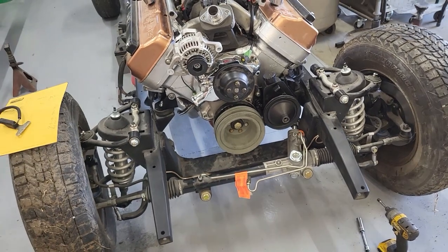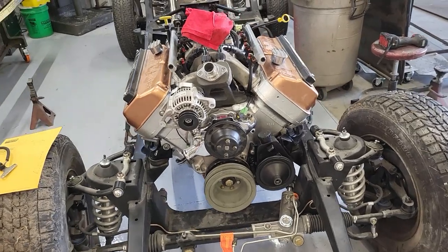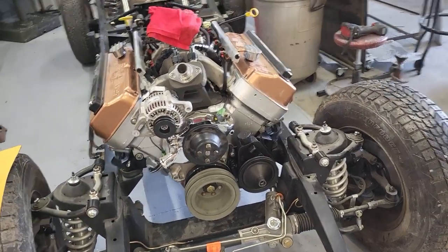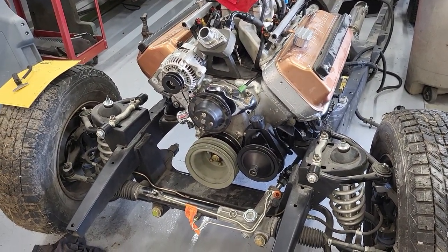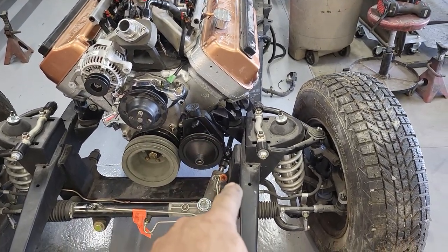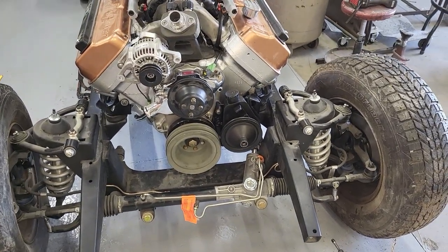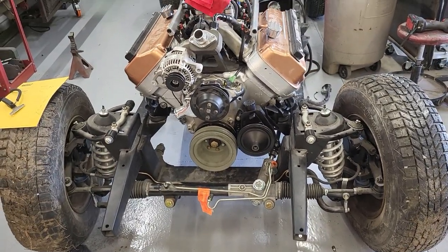I think at this juncture I'm going to get the vitals on first — the alternator and the power steering pump — and worry about AC down the road. At this point there will be two belts: one for the power steering pump and another for the rear groove of the alternator. The power steering pump fabrication took some time, but now I can get the hose routings done — return will loop up then straight down, supply will come underneath and hook over. There's plenty of room. Looking good — thanks for watching.